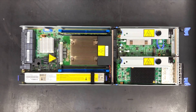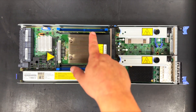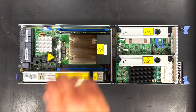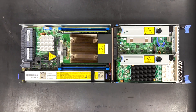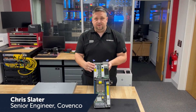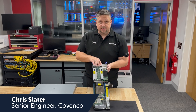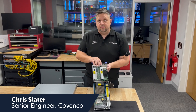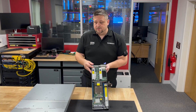Some of the essentials of the node canister are the CPU — a 12-core processor — and the RAM, which can scale up to 256 gigabytes per node canister for a total of 512 per enclosure. Towards the back, we have the ability to install HBAs. Much like any x86 server, we can install Fibre Channel HBAs, an Ethernet HBA that will support iSCSI, and importantly a SAS expansion card as well.